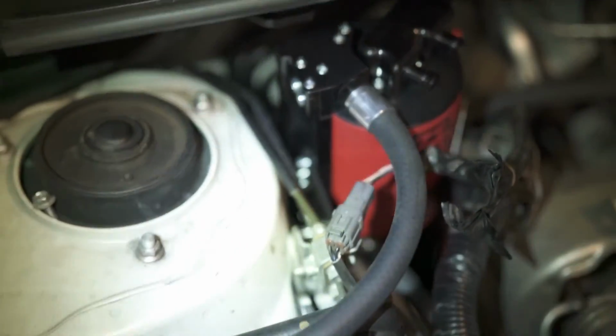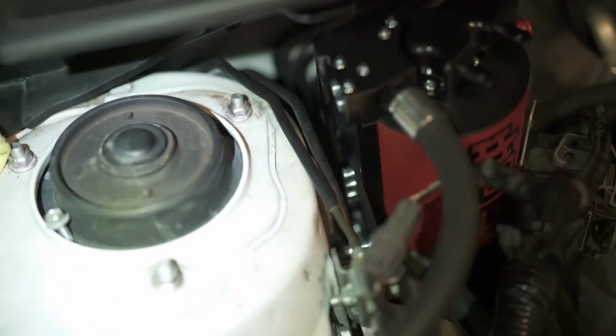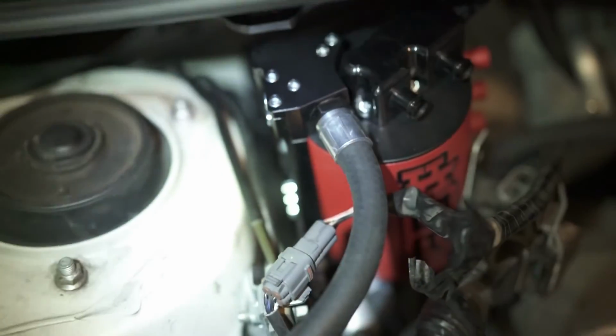What we're going to do is that from here, the coolant is going to flow to the top. This line here will connect to there, and it'll go through, cool the air oil separator, and the bottom coolant line of the AOS will snake around, and that's what this one is, we're gonna replace that with that.